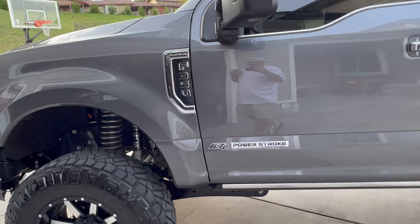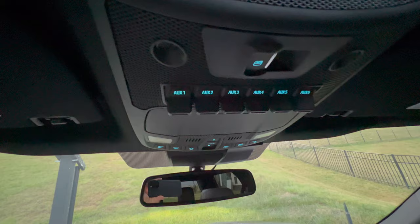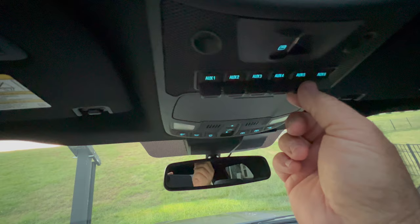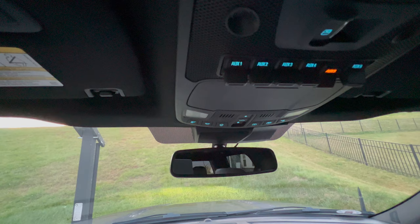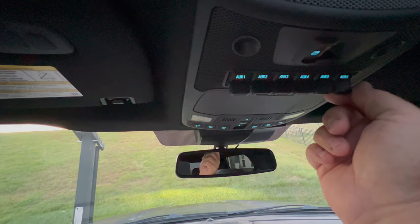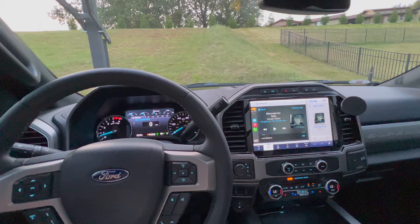This horn is absolutely insane. On the switches for your system, I highly recommend putting your compressor on a switch, not straight wiring it to your battery. Because it's almost impossible to have any system like this without some sort of leak. I keep mine on number 5 — both compressors just kicked on inside the bed of the truck. With the radio up you really can't even hear it. Once the compressors reach 165 PSI they'll both cut off. Number 6 is the button that actually engages the horn. I highly recommend putting those on separate switches so you can turn the compressor on only when you want to use it.